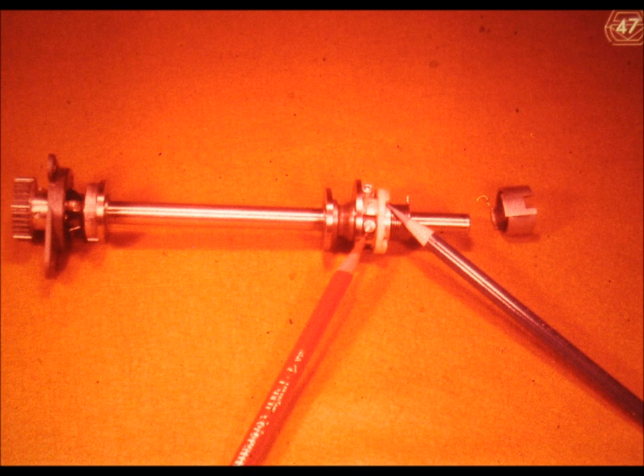On early level or level 1 machines, the overthrow stop looks different. The difference between the two styles is minor. The cycle clutch latch restoring cam, indicated by the blue pencil, is held by screws (red pencil) which screw into the clutch clamp. On level 1 machines, the restoring cam is simply positioned outside the clutch clamp. While this may make the clutch easier to adjust in separated steps, this mechanism works just as well as the later model.